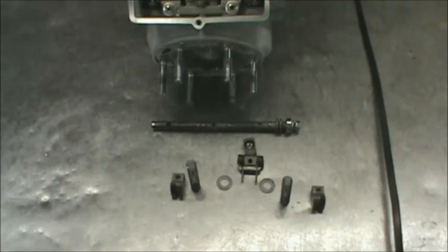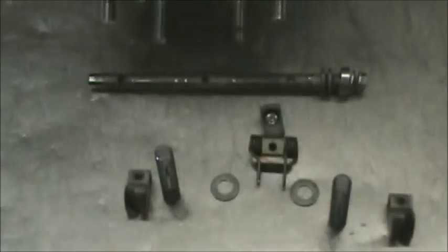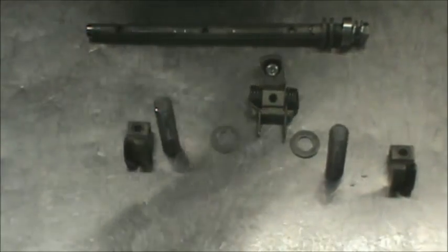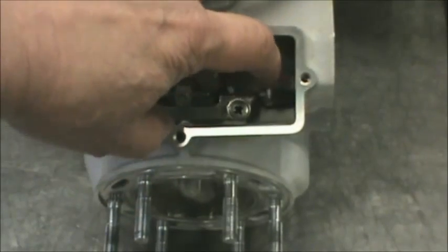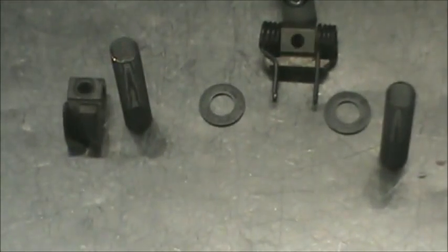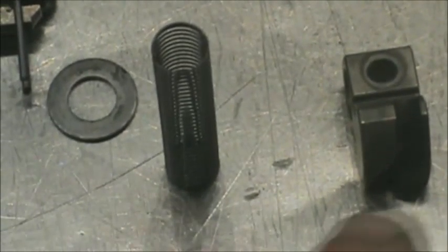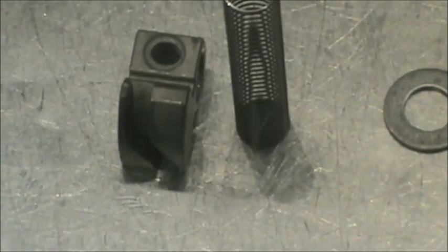Here's the rest of the components — a good majority of the rest of the power valve components. We're going to put this shaft through, but all of these pieces have to slide over that shaft as it's being pushed in from this side of the cylinder. These two pieces are going to move the arms for the sub exhaust, and those have to be put in in the correct spot. With the cylinder upside down, you want the notch towards the outside of the cylinder on both sides.